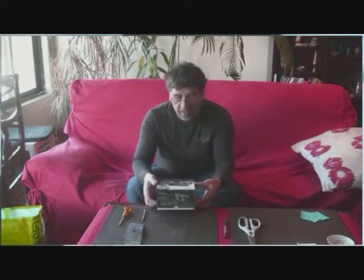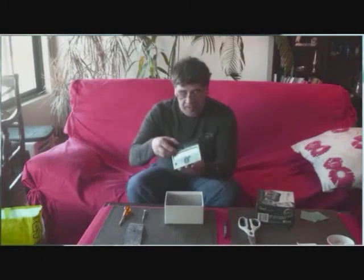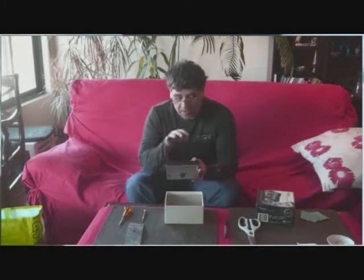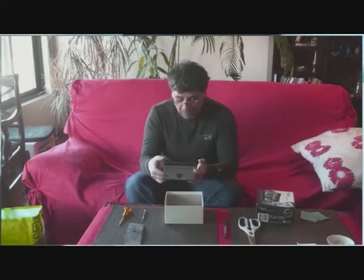Now, these watches have one problem. In fact, they have a lot of them. But the most common is about the time button. This button here, where the players switch their times. And with usage, this button tends to fail. It doesn't stay in one of the sides. You know, you press it, the time doesn't change here, because the button doesn't stay in one of the sides.